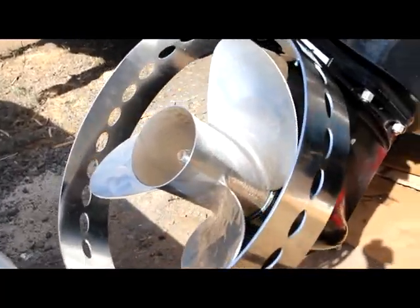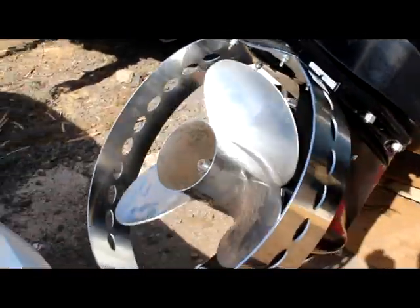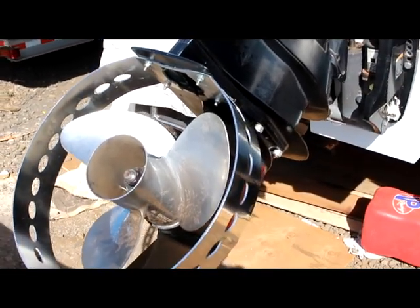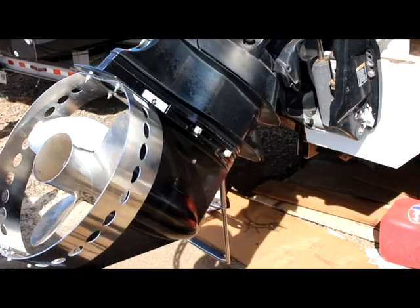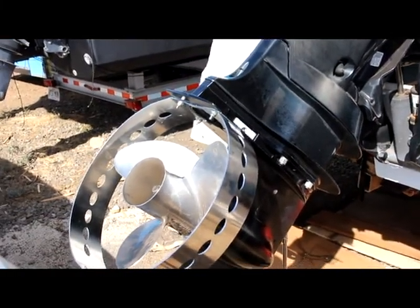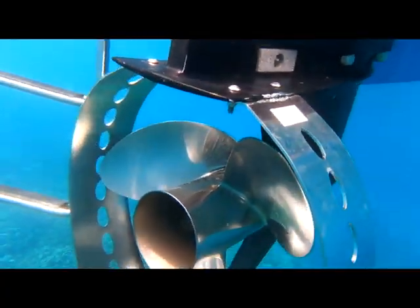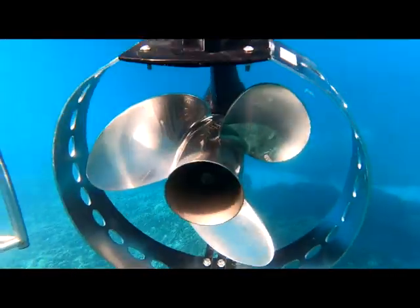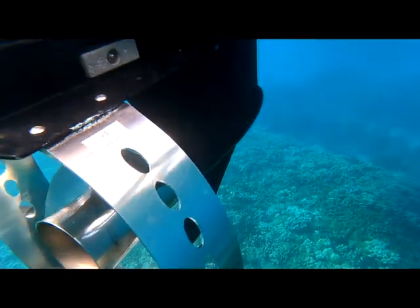Here's the finished product — all installed, everything tightened, spins good, no interference. I'm going to give Adventure Marine a five out of five. The fasteners were a little long but that's no big deal — I think they did that so it fits a variety of different outboard engines. Overall the quality and construction are really high. The rumor is this costs about five miles per hour off your top-end speed, but it's not really going to matter on this boat. No vibration, no noticeable drag — it's a top quality part. I'll give it an A-plus from Adventure Marine in Canada. Now the swimmers and the fishies are safe. Thanks for watching.